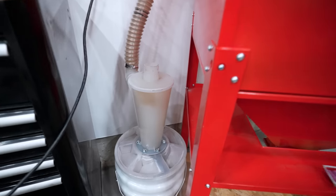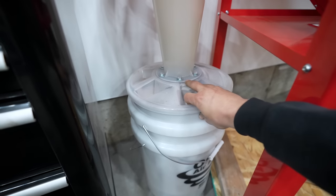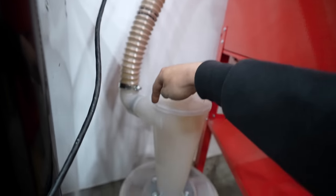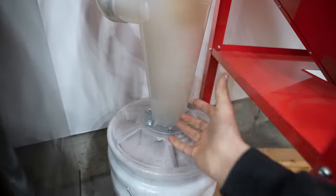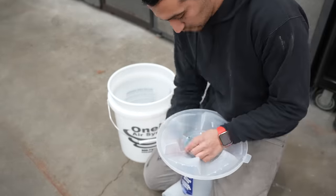The bucket and hose attached to the side here makes a very big difference. The vacuum does a very good job at sucking up all the airborne particles, but the problem is that if it gets sucked into the vacuum you pretty much have to throw all that stuff out — meaning you'll be buying more media pretty much every time you use it. That is why I purchased what's called the Dust Deputy. The basic version is just this unit and you rig it up to a 5-gallon bucket — it allows the air pulled from the side of the unit to go through here and spin around, and the vacuum basically just pulls air through it instead of bringing all the media up with it. I'll have a link for both the deluxe version and the basic version in the description box.